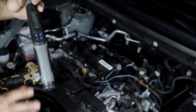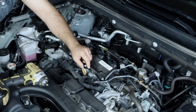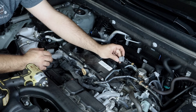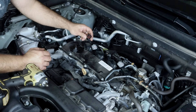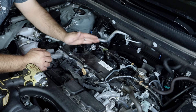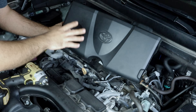The torque wrench I have is professional grade and does have inch-pound settings, so I'll torque these to 66 inch-pounds. Now that they are torqued to spec, let's plug in the coils. One detail Toyota does across the board: you'll notice one gray connector and one black connector, alternating — gray, black, gray, black. The harness won't allow you to plug the wrong one in, but it's a good thing to be aware of so you know you're plugging in the right one.